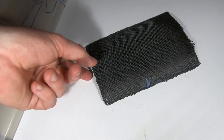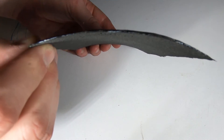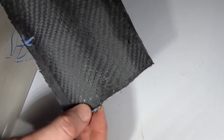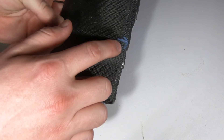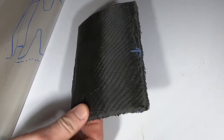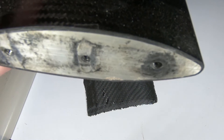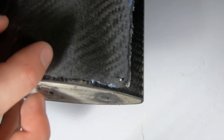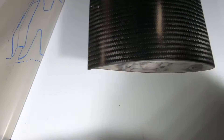Here we have the doubler — it's a pretty thick piece of carbon fibre, about three millimetres thick. The ends are a bit raggedy but I haven't cut them off yet, no need. It's actually got a forward and a backwards — this is the forward marked out here — just because the wing itself is not symmetric. So it kind of sits there, and if you do it the other way around it actually slides and flips off.